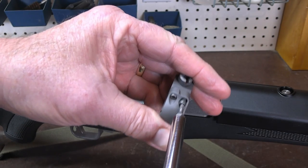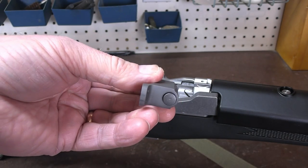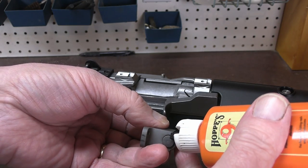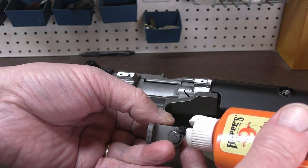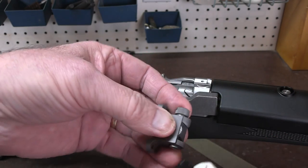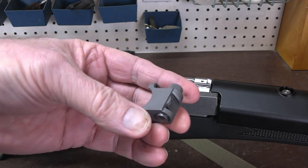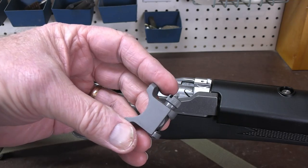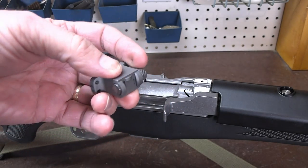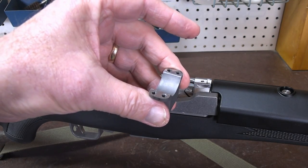Remove the tops from the bottoms of these rings, and to prevent binding of the screws as you're tightening them, take a drop of oil and apply it just at these openings — apply it to the thread and that's all you need. That will assist you in tightening these threads up. That's a machinist trick: if you want to get threads tight, use some oil. The oil can be removed afterwards, but it will assist the threads in slipping.